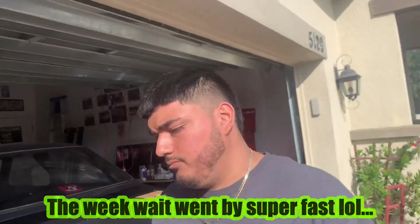All right, guys, we just got a call from Tony Futek. Our turbo is here. We just found out that we bought the wrong head gasket. The head gasket we bought was a solid copper head gasket. That's for cemented blocks and stuff. We still run water and everything in our block, so we gotta buy one with the holes so the water can go through the block.